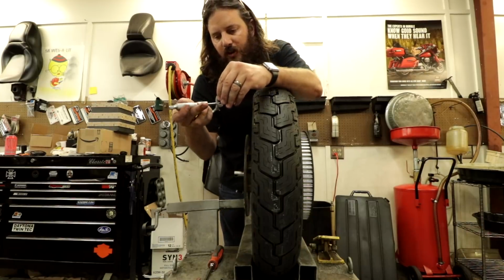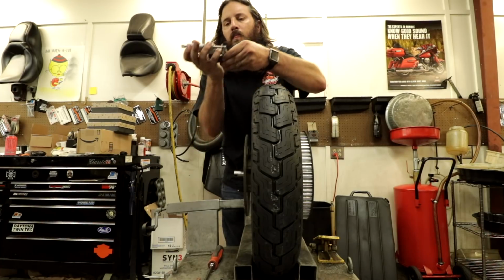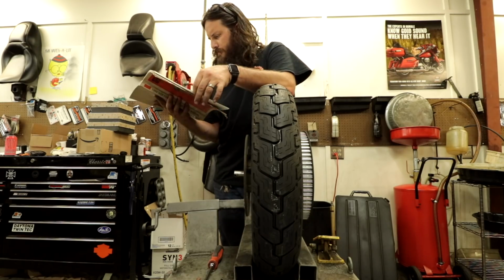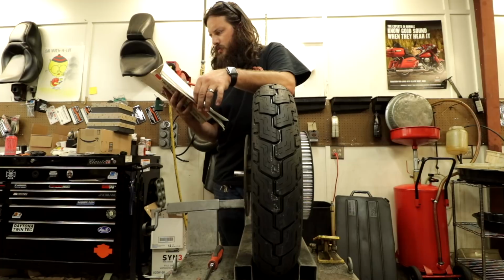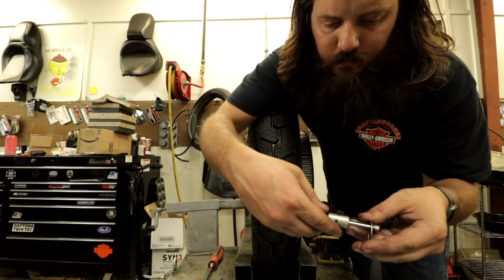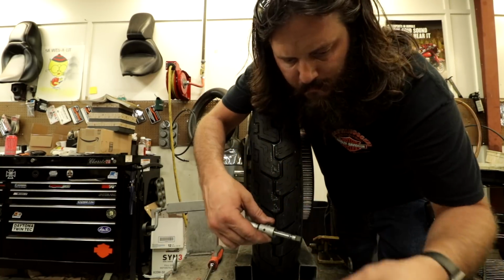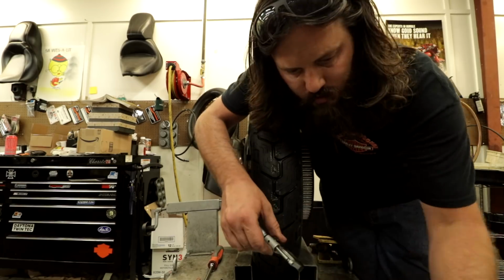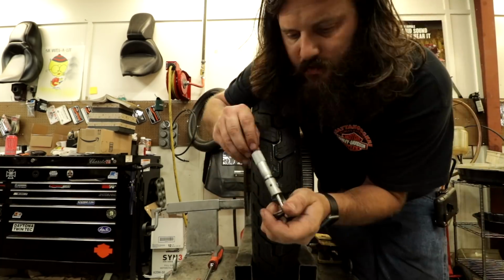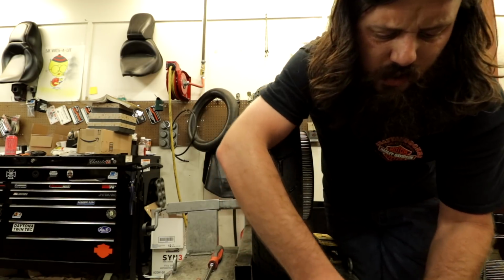All right, I'm roughly 1/1000th away from where I want to be. Double check the old manual. So using what few spacers I have, I want to go to like 0.03. If I'm at 0.034, I want to go to, if you can read that, 0.035 now. So I'm good. That's just what I wanted.